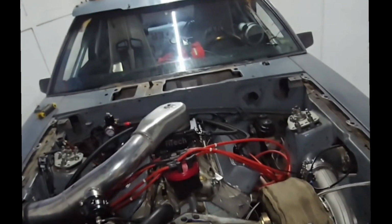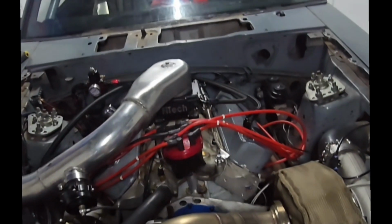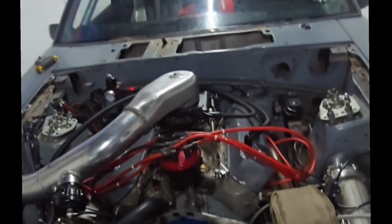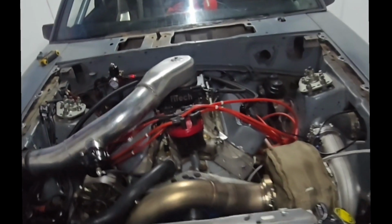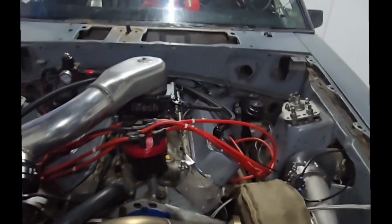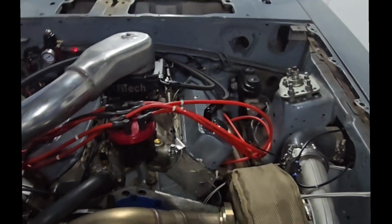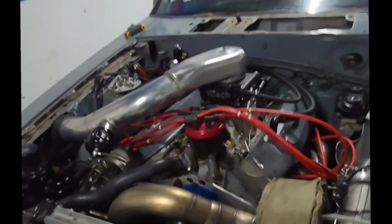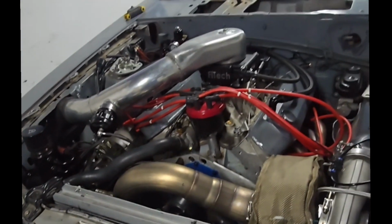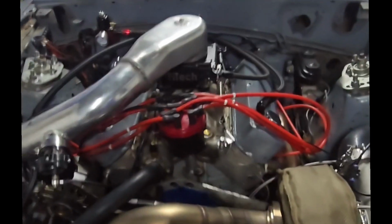All right, so these cylinder heads have a 650 spring rate. So with that, I am running a custom Comp Cam with a 623/633 split lift, split duration, with a 114 lobe separation. It is a hydraulic roller cam, so I'm running the Howard roller lifters with a 1.6 Scorpion rocker arm. So as far as the engine, it's as plain as you can get, off the shelf parts other than the custom camshaft, nothing spectacular. We motor plated it, and honestly, that's about it.